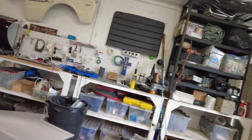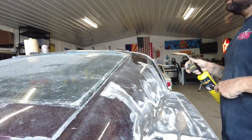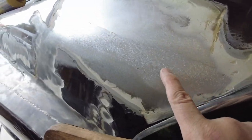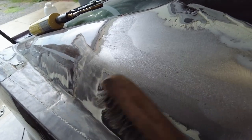One of the things I have to do on these cars — there's a lead seam right about here. That's where they let it in at the factory, joining the quarter panel to the roof skin. On this replacement panel you can see a better picture of it right there. What I need to do is get down to the lead and scrape it out. The quickest way to remove all this is with fire. You can see the difference in texture — that's the lead seam. I'm going to heat it up with the map torch and then brush it out.